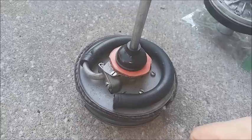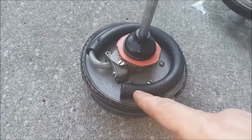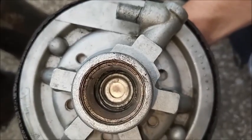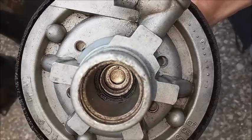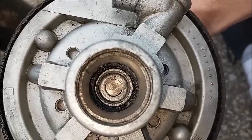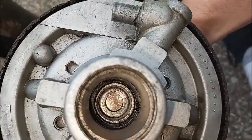The manual doesn't talk about any clamps, but I've definitely needed clamps on my Delco, so clamps might be needed. You just have to be careful how you put them in there so they don't get in the way of the operation. To finish off the Delco Moraine piston, there's a measurement that needs to be taken of the difference between the distance straight through the center to the bottom of the plunger and to the ring around that, which is part of the reaction mechanism.